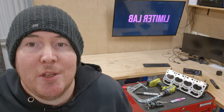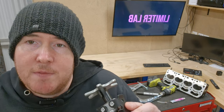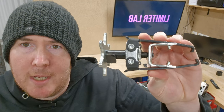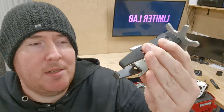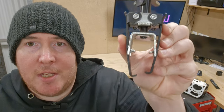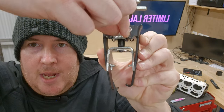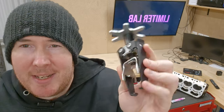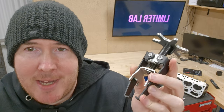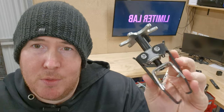So let's get into the tools that you need to get this job done. The first style of tool you can use is this little spring compressor style. I honestly don't know why I have this one, but essentially it goes down on the spring — you turn this down, it compresses the spring allowing you to undo the collets and take it off. But I don't like spring compressors. I don't like creating little grenades, so I would try and avoid this one. There are much better tools on the market.